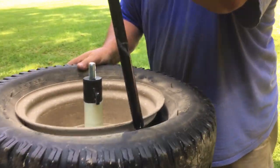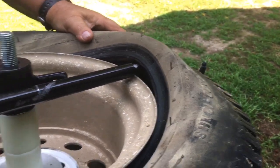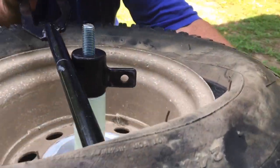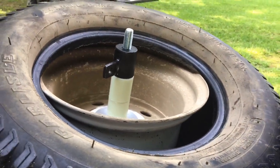Of course it really helps if you're about 260 pounds when you're pulling on that thing. Once you get it broke loose, you take that little bar and get it under that tire and brace it against that piece right there and start working your way around. And it just runs that baby right off of there. Look at that — that's done. You know how long that would have took me and how many busted knuckles I'd have trying to use a couple old screwdrivers to get that thing off.